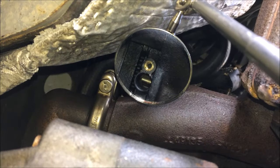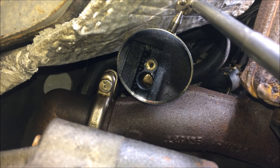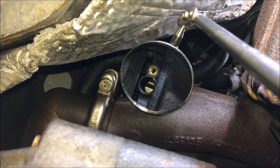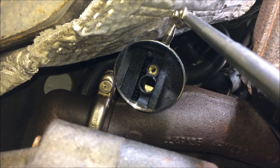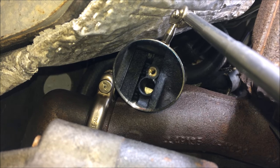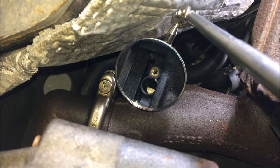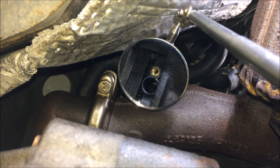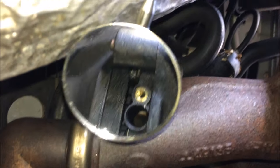So now you can see — through my mirror I'm just showing you where to drop in the locking tool, or you can also use a 10mm allen key. This is to lock the crankshaft in place to ensure that you've got perfect static timing. This is at the rear of the engine through the crank position sensor. You remove the crank position sensor and you get access to the flywheel, where you lock the flywheel and thereby lock the whole engine into static timing.